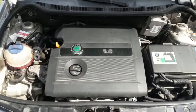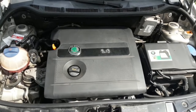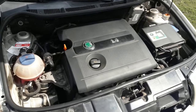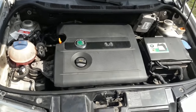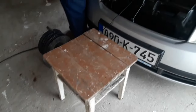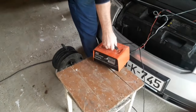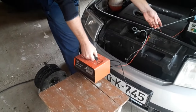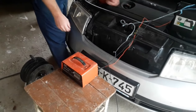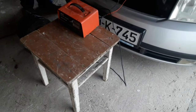The position depends on the engine bay and where the battery is positioned. Whatever place you choose, the most important thing is to put the charger in a safe, dry, and stable place. Another option is to use a chair or stool and put the charger next to the car near the engine bay — this way there's less to worry about. Also, if you're using an extension cord, it's preferable that the connection between the charger and cord is outside of the engine bay, just in case.